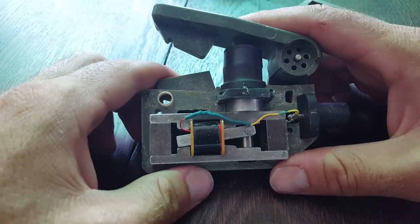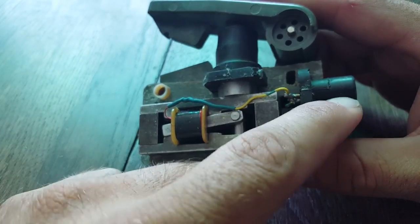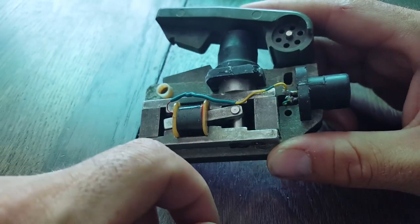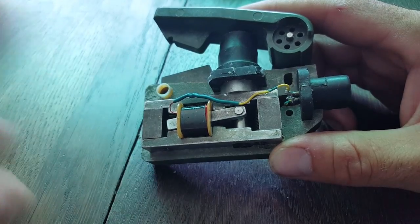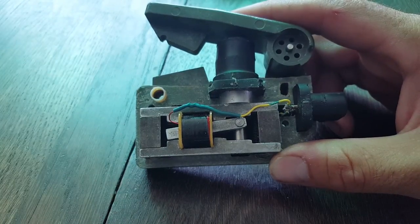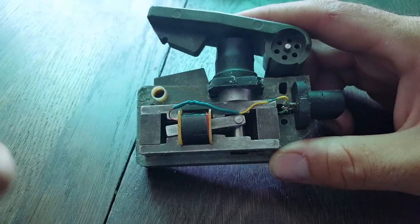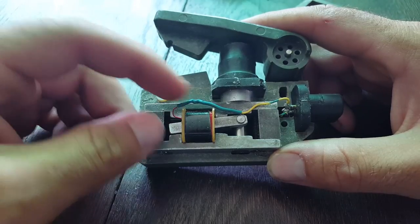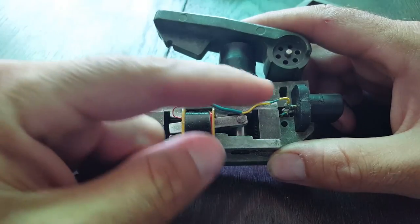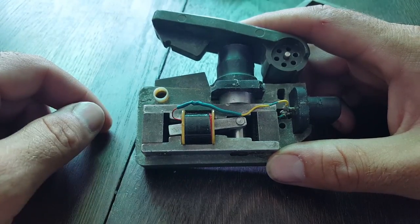Right there is what you have. I found out I had two issues. The soldering was causing problems because it was badly done and had started oxidizing, so I decided to redo that. While I was redoing it, I could tell the original wires weren't working properly — they had problems too. Instead of trying to fix them, I just put new longer wires back through. And that's what you have here.